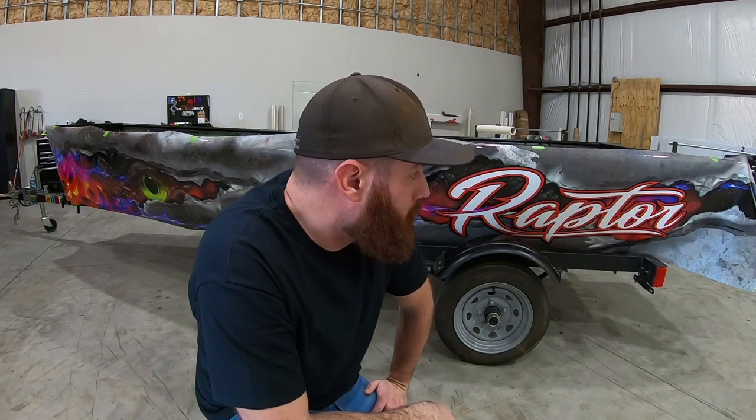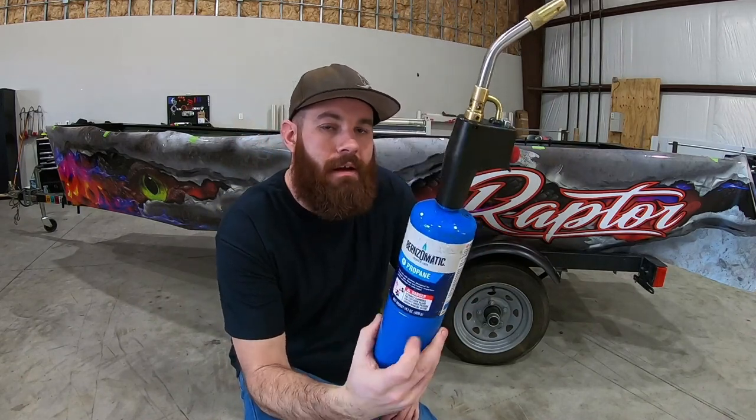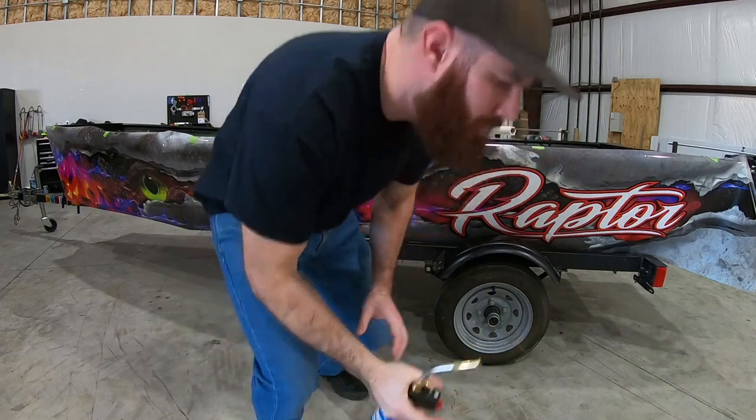You're also going to need some type of heating element — whether it's a heat gun or a torch. I'm going to go ahead and get my torch out because you're definitely going to want to do some post heating. On these recesses with the little triangular grooves, you need to heat it up to get that vinyl nice and pressed in there. If you try to cold roll it, it's just going to pop out. For the torch, you can use the blue cans or the green camp cans — just the yellow propane cans burn a lot hotter so I wouldn't recommend those. For the backer paper removal, if you have somebody to help you, you can pull the whole backer off and just float the panel together with a partner — a lot faster.